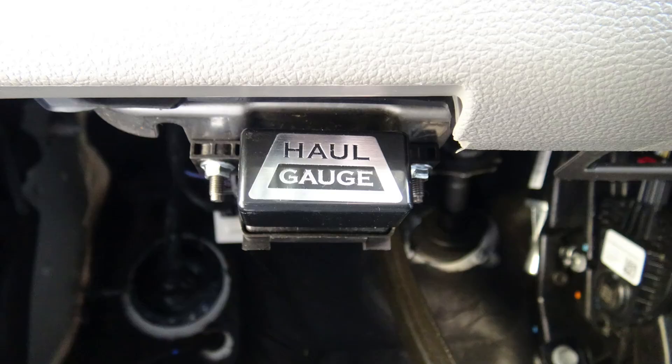You're not guessing - this is so cool. You don't have to always go find a scale. They're not easy to find and they're expensive. Even most of the semi scales are off maybe 20-pound increments. It saves you time and gives you the knowledge of knowing you're not overloaded, because that happens a lot. People don't know what their trailer weighs and you're wondering why the brakes are burning up or why they're swerving all over. It's right on your phone and you just plug that computer into the onboard diagnostics port under your dash and you can calculate everything.